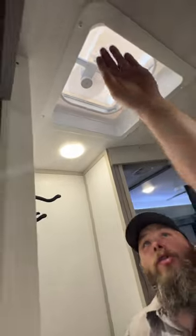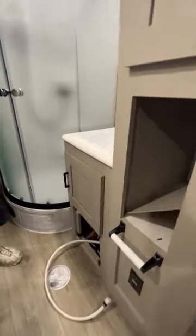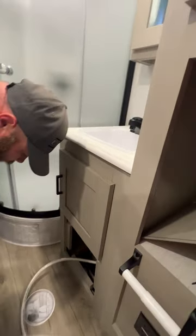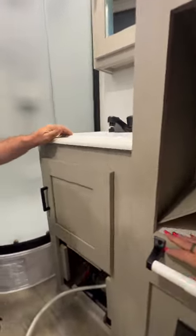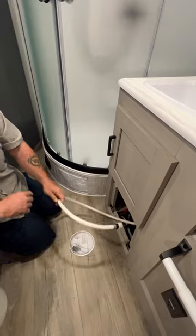In here, you're going to have your light switch. When you turn this on, it does also operate your fan, but you can also turn that fan off with that switch right there. You've got your medicine cabinet and storage space. This is actually where you are going to go to winterize your coach. Down here is going to be that third knob I was talking about when you go to winterize — right now it's actually in line with the fresh water tank. Whenever you go to winterize, you're going to turn that knob so it's going to be going from this hose here into your antifreeze, and then you're using the water pump to winterize.